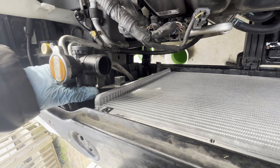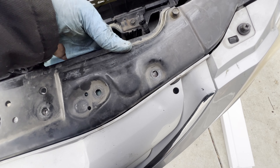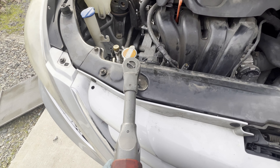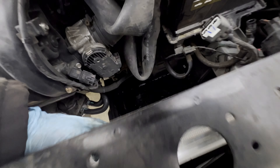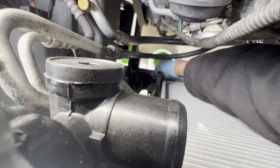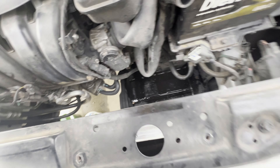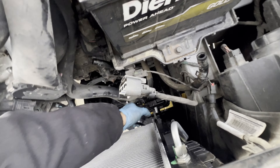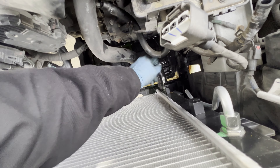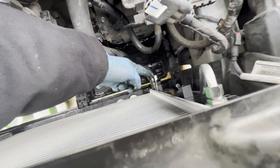That's it. Bolt it down — two here and two on this side. Let's go ahead and put the bolts in. Those are good. Double-check the bottom, make sure it's not moving, and make sure the drain plug is closed. Time to put the hoses back in. Start with this bottom hose — this one goes here and this one goes here. Clamp that. Then reconnect the two transmission line hoses. We've got all the hoses back in — double-check your work and make sure everything is good.